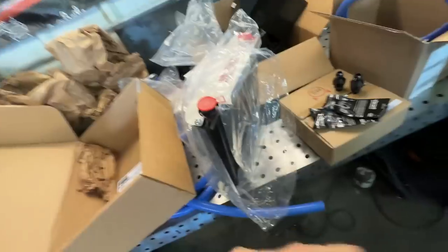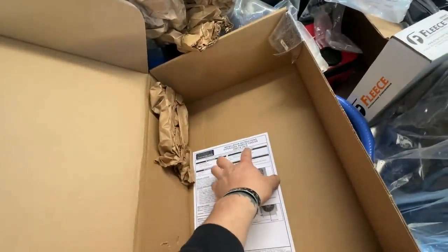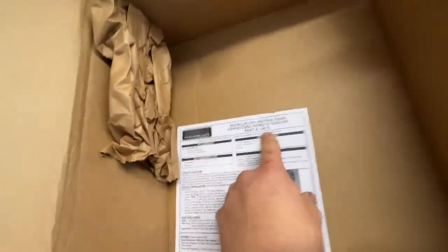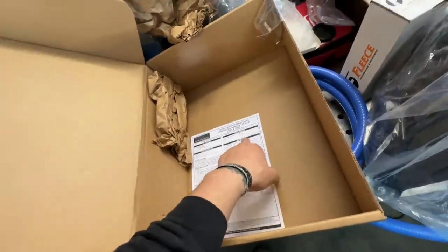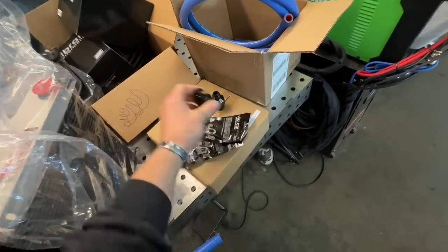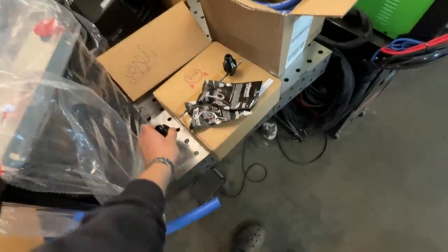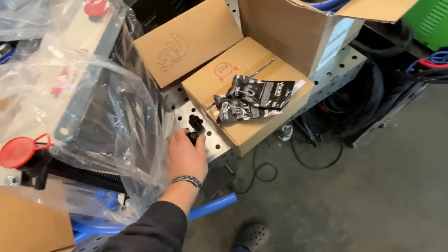All right, so to do this project, we have this Derale cooler, 15876. I don't know if I would order this one because this is actually a 10 in and out. Luckily for us, in stock, we have the 10 to 8 adapters right here. And I might actually have the O-ring boss to dash 8. Once I saw these, I stopped looking.